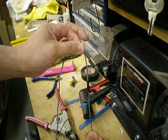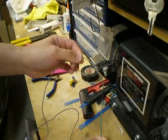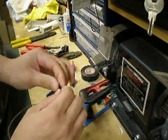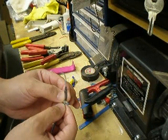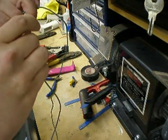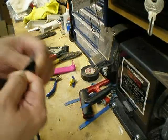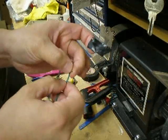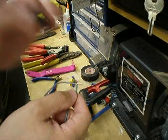This is a big, big no-no. And the reason you don't want to do that is, for one, if you want to pass any type of high current through this — such as using it for fog lights, a 12-volt power source — what happens is that after probably one good summer, when this heats up in the car and it gets very hot in the car, the adhesive on the electrical tape will start breaking down. When it starts breaking down, the tape will start to unravel, and you could cause a short if other wires get into contact with this wire. Also, the adhesive will actually work itself into the individual strands of wire inside this conductor. Next thing you know, you've got a connection that's failing. So do not ever do this.